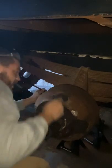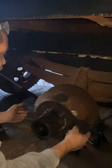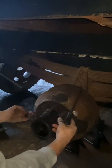Okay, now that we got all that, we are going to use one of these, clearance rack, Harbor Freight pry bars, in order to break this loose. Sorry, there's traffic going by. And sometimes you have to hit these things, I know the first time I did it, I had to, with a mallet or a hammer. A metal one works better than a rubber mallet most of the time, to break loose the rust that's holding it together.